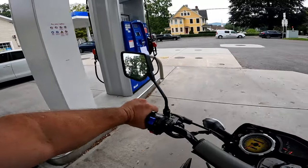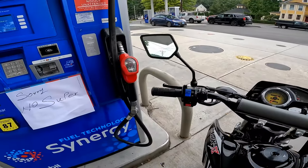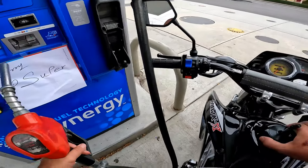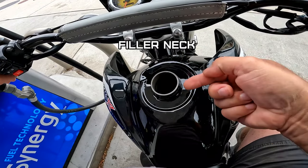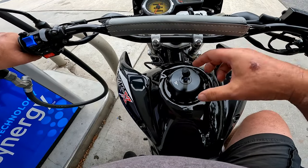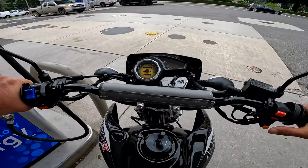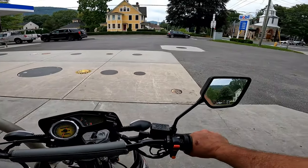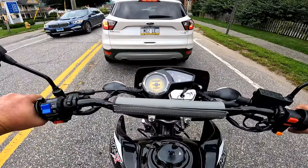Let's get some fuel! No super — hmm, no super. Oh well, guess we're not getting super. I noticed in this gas tank they dropped that filler neck way down because they were having problems with gas splashing back up on you. So probably if you fill it all the way up and you're driving around, it levels off at a lower point — that would be my guess why they did that. It should start in gear with the clutch in because it has a clutch switch. Yep. The idle's a little high but not horrible.